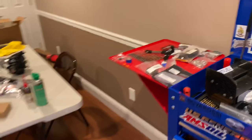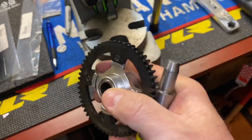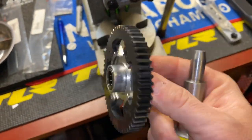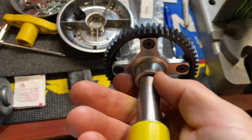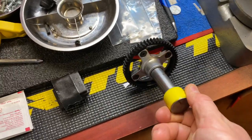The one-way bearings we're going to be using are Team Fast Eddies. If you have a tool like this - an arbor press - it's quicker and easier. You have different adjustments here. You don't want to mess this up - you want to make sure this guy is free. Don't be putting pressure on something and damaging it. This is just an easier, better way with less chance to damage or nick your two-speed setup. This is an important tool to have. First thing you want to do is check your one-way bearings before you remove them - you don't want to reverse them. If you put your one-way bearings in reversed you're going to damage your two-speed or your clutch.